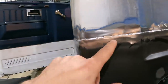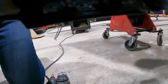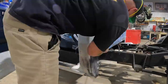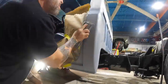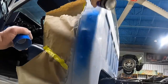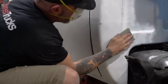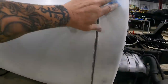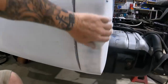We went ahead and welded all the way around the outside of the truck on the back side. I put three spot welds back in where the inner structure is, welded on the underside, and got this all welded in — so this panel is pretty much all set. I did some bondo work, sanded it down, and tried to make it look patinaed like the rest of the truck. We didn't want this new cab corner to stand out and look all fresh, so a couple of coats of paint, some sanding and buffing down, and she's looking old and rustic, just like the rest of the truck.